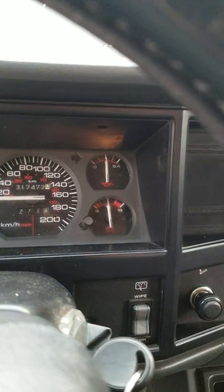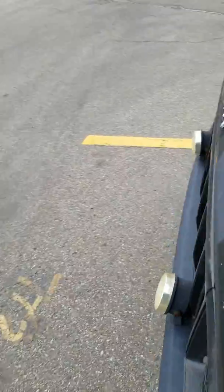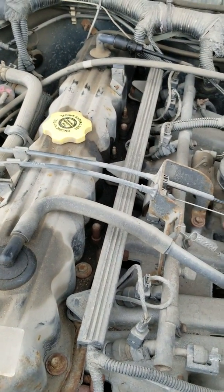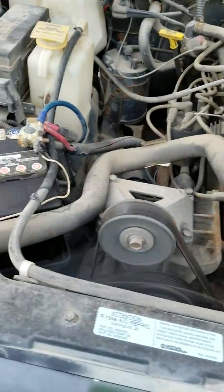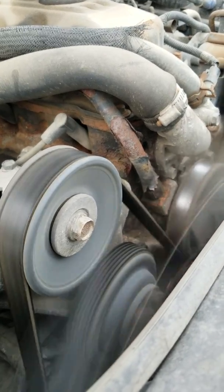You can hear the clutch until you put your toe on it. It's got good oil pressure, alternator's good, fuel always says it's full but it's not. Revs good. It only did that squealing since it sat. It sweeps a little bit by the water pump — probably change the water pump gasket and go again.